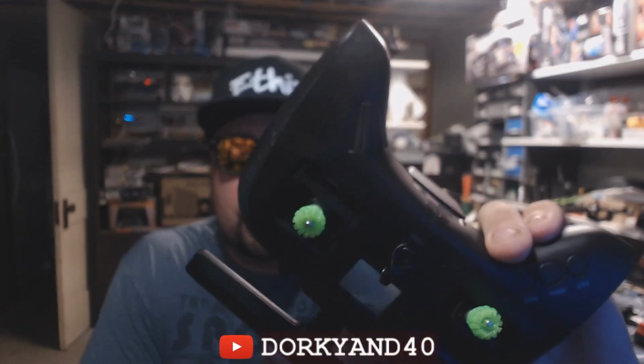The other thing, when it comes to putting in your gimbals, they do drop in and kind of slide into place, which is easy, but the biggest problem is going to be that scroll wheel. Getting that scroll wheel lined up back in there was the trickiest part that I had. So keep an eye out for that, because it goes in and kind of sits, but then it's got to come down and roll and click.